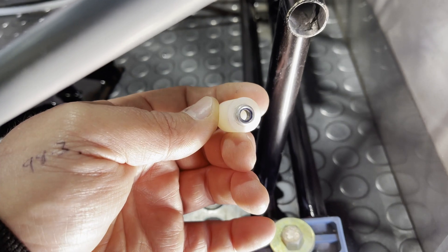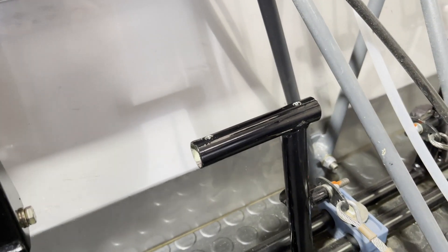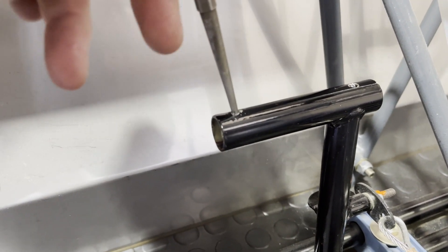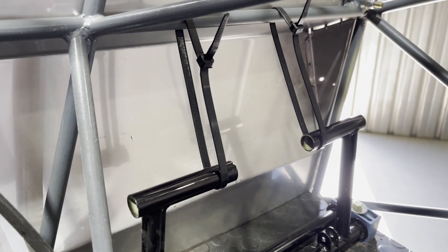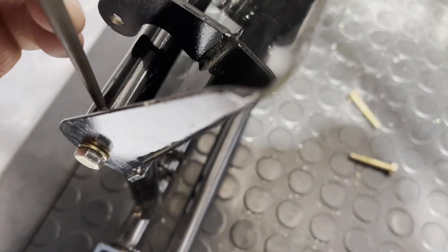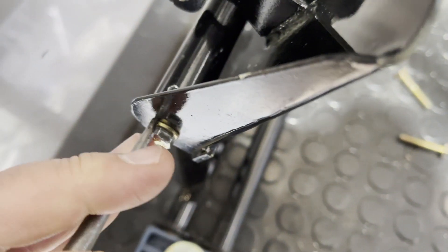The nylon bush has got a nylon lock nut inserted on the inside. On the pilot side I've already started this process — I've drilled the holes on top and I'm going to use this sharp pin to hold the bush in place while I'm tightening the nut. I've used some cable ties to hold the rudder pedal in place, otherwise the pedals will be falling forward. This process is much better done before you install the rudder pedals, as cleaning the bushes and dry fitting is easier outside the aeroplane. While tightening the screw, I'm just pushing the pin into the nylon bush to hold it tight.